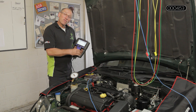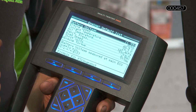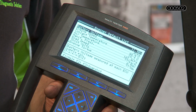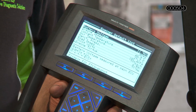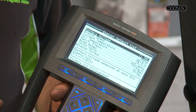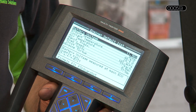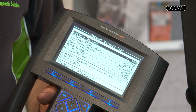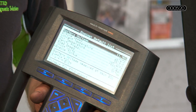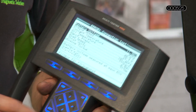Based on that value, we can be assured that the 5-volt supply, the ground reference, and the plausibility or coherence of that signal is getting back to the ECU satisfactorily. So initially I'm happy with that. The next stage is to run the engine and monitor the actual value of the sensor, both serially and with the gauge. With the gauge, I'm expecting around 20 inches of mercury. Let's see what value the scan tool interprets that as well.